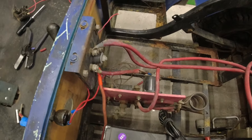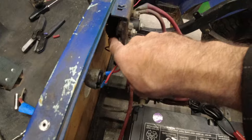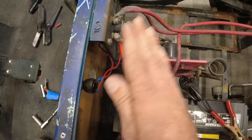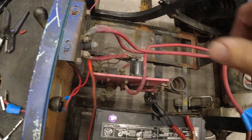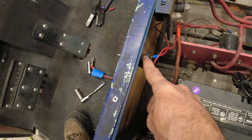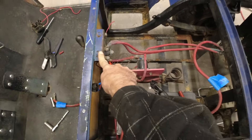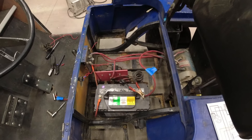I have to figure out how I'm going to wire this, because the current setup is all on six volts. We had a single positive going to our ignition switch, then to a safety switch making sure you're fully in forward or reverse, then down to a third switch ensuring the pedal is depressed before sending voltage to our solenoid, which opens up the connections for everything else. I need to find a 36-volt solenoid and make sure the pedal and reverse switches can handle 36 volts. Then I'd like to remove the control board, clean it through my ultrasonic cleaner, and make sure all connections are in good shape before hooking up our Vatrer battery pack.